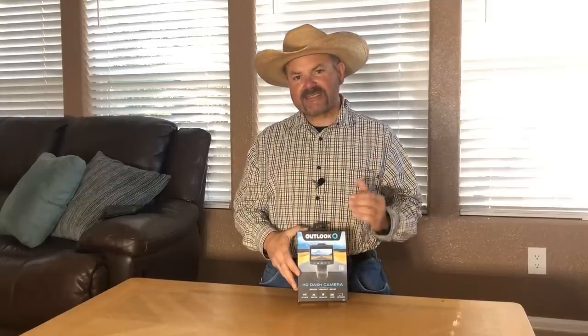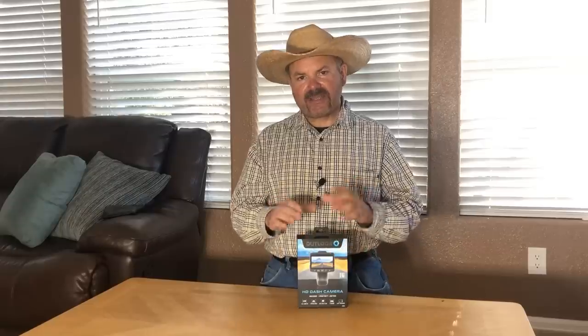On the box here it says it will record up to 9.6 hours of video with a 64 gig card. I did the math for you and that comes out to be about 9 minutes per gigabyte. Included with your cam is a 16 gig micro SD card and with that you should be able to record about 144 minutes or 2.4 hours of video. It records in small sections of time and loops those — as your card becomes full, new video comes in and the old video is deleted. The 16 gig card supplied with this unit should be more than sufficient and you won't need to buy a card to make it work.